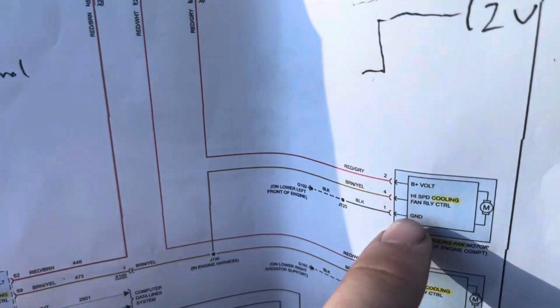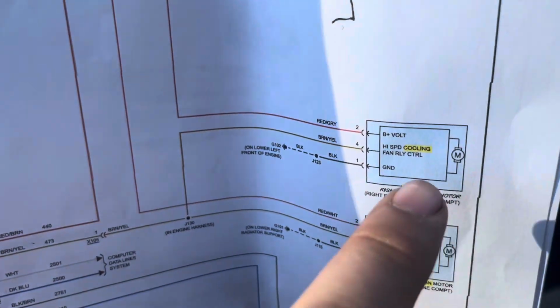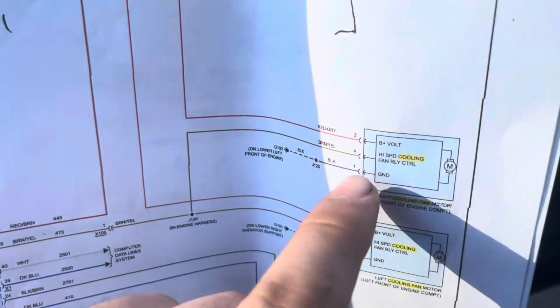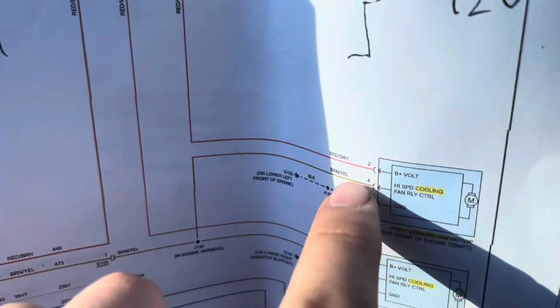So before I call a whole fan assembly, I have to check this wire. You kind of want to make sure you diagnose this correctly, because I think I found a cheap assembly for like maybe $800, and that's not cheap. You know, that's the cheapest, is what I meant to say. So you want to check this brown yellow wire. With an oscilloscope, I was able to diagnose it pretty quickly. If you don't have an oscilloscope, I guess you could try to ohm test with all this disconnected.